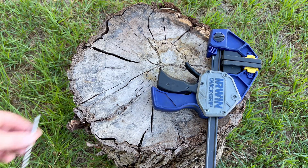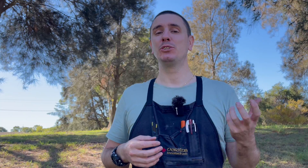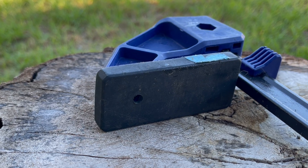All that's required to make the first tool is a clamp with rubber jaws, a drill bit and a piece of tubing. All we need to do is drill a hole into one side of that clamp — I recommend you do it on the side that doesn't move. Then take your piece of tubing, slip it in, and make sure it's just protruding a few millimetres — 3/16th of an inch — inside those two jaws.